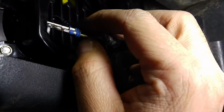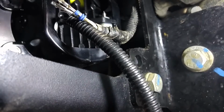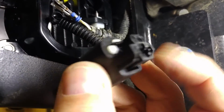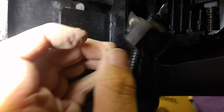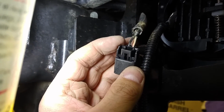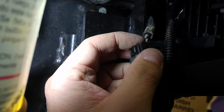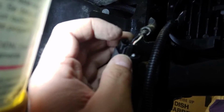And then you have these plugs that are now exposed, and Mopar provides you with the replacement. Okay, so we just replaced the OEM plug with the one supplied by Mopar here, and essentially the black goes into the B slot, and this one is a reddish white blend here, slides into the A pinhole.